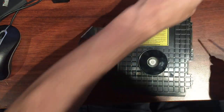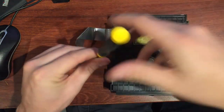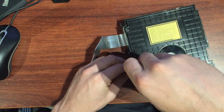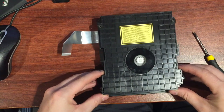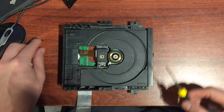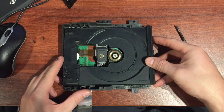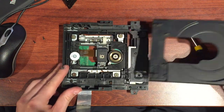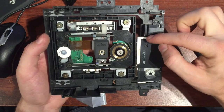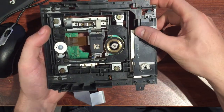Some down the sides as well — another one down there. This will just lift up. To get completely into the CD mechanism, you first take out two screws on the side — just little ones. Then if you lift this mechanism up on an angle, the whole tray will just slide straight out. That's how you take out the tray. Get right in here and have a look. One thing to check is this white piece — it moves the whole mechanism. Just put some pressure on it and slide it to make sure the mechanism is smooth and that big gear is rotating.